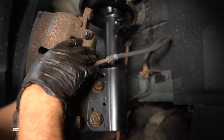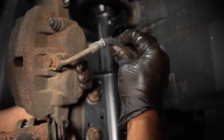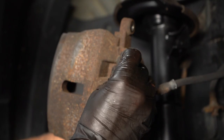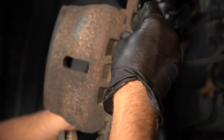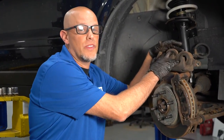While you're here looking at the caliper, make sure the brake hoses look like they're in good shape and make sure they're not cracking. If there's excessive rust on the brake hose or even the bleeder screw, with the caps on them they tend to not rust through like others that don't have the caps. Check those out. In the event there is something wrong with the caliper, you're just going to have to replace it.